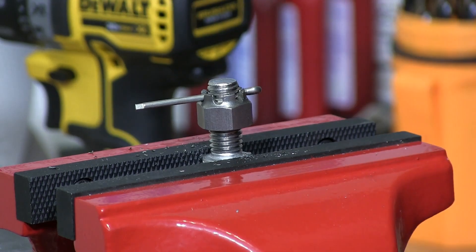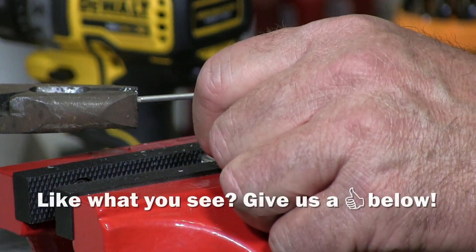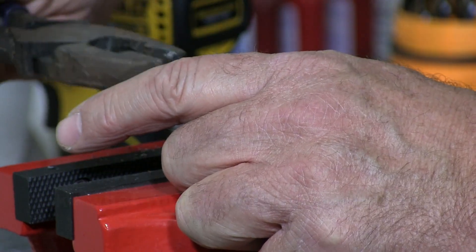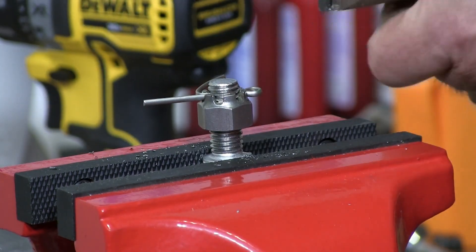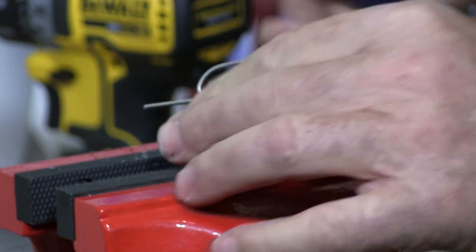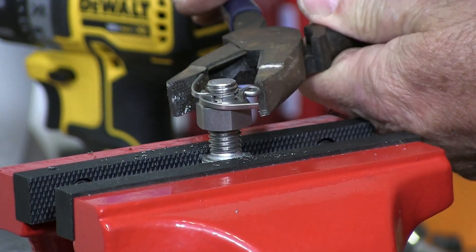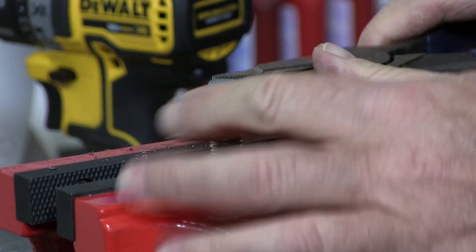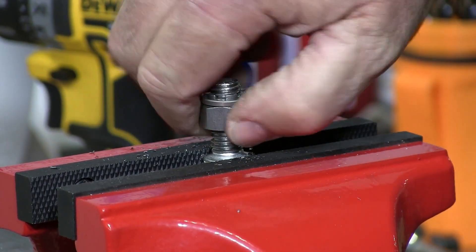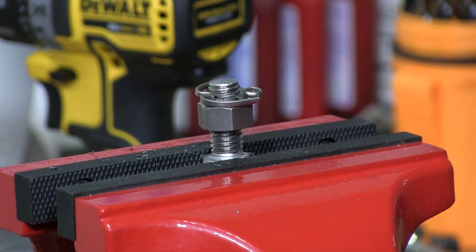So I'm sliding that through — there's your cotter pin. I'm going to grab a little pliers here. I'm going to bend this around to lock this in place. So make sure that your wheels don't pop off if it's going on your car. This is your protection. And then that's not going anywhere — it's locked in place. And that's the whole mechanism behind a castle nut.